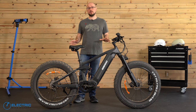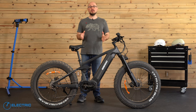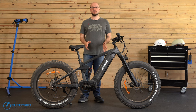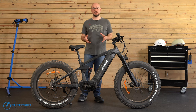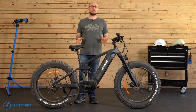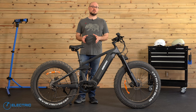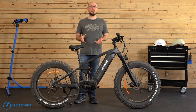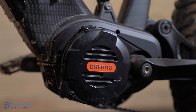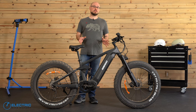Let's dive into the Cobra Pro's full list of specs, and then we'll get into its test results a bit later. We already talked quite a bit about the power and benefits of the Cobra Pro's thousand-watt Bafang mid-drive motor, but I do want to talk upfront about one important aspect we haven't covered yet. E-bikes are typically separated into three classes, which in many cases determine where they can be legally ridden. That three-class system places a cap on motor wattage at 750 watts. We always recommend that you check your local laws, but the fact that the Cobra Pro has a thousand-watt motor means that it falls outside of that three-class system, and in many locations it will only be legal for off-road use. This is where the Cobra Pro is meant to be used, so it makes sense, but it is something to be aware of ahead of time.